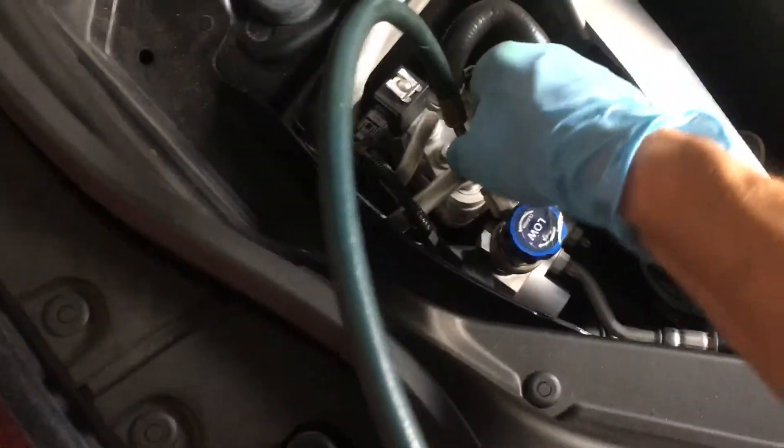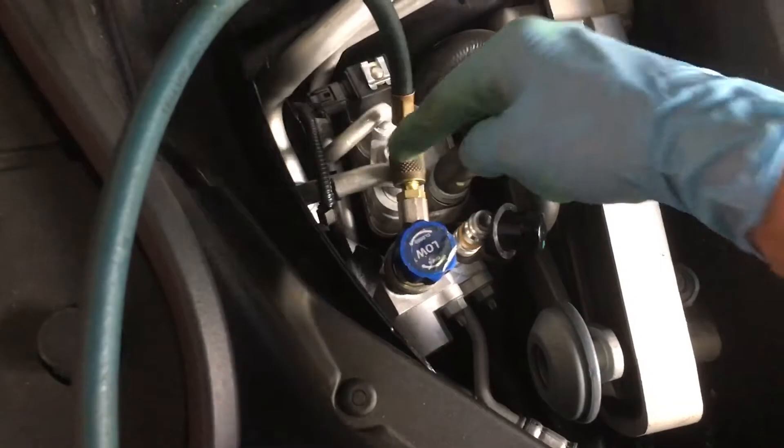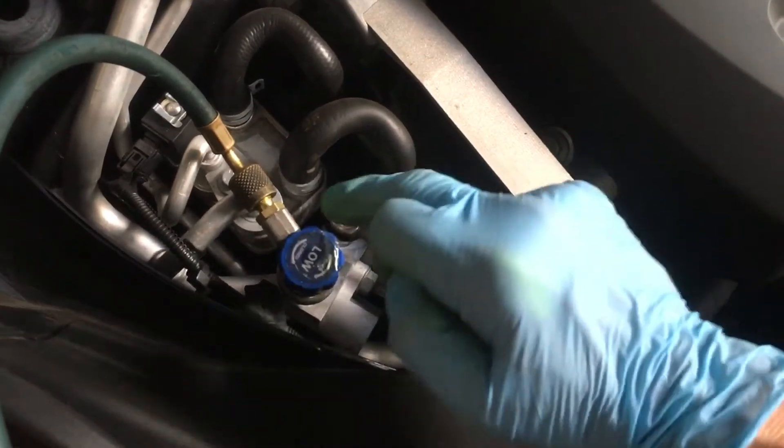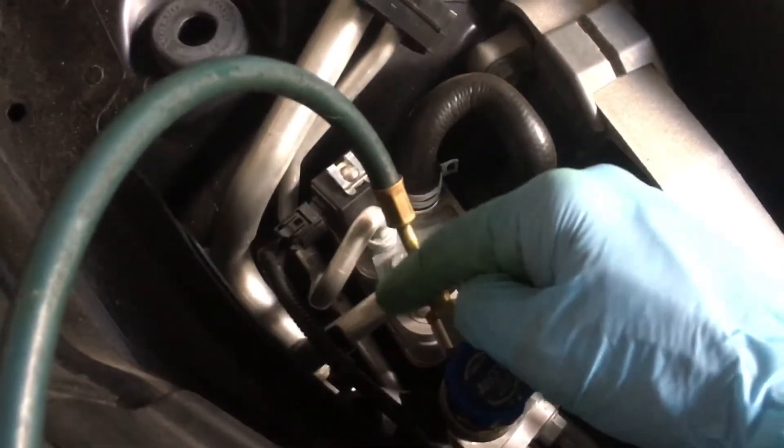There's a glycol loop. I'm sorry, I spoke too fast and wasn't looking good enough. Look right here — here's your coolant lines, these have glycol in them. Here's your refrigerant lines. So where's the expansion device? We have high side line, low side line into one block. They're using this one terminal block so you can tap into the high side and the low side. Then it tees off right here where you can see. And then it looks like they have a little solenoid valve right here — see that big metal pole coming up the middle? That's to make the field coil to make the magnet to pull up and allow the refrigerant to flow through. This little tiny plate heat exchanger. So this is the glycol loop with the refrigerant to cool off the glycol.